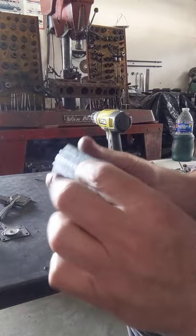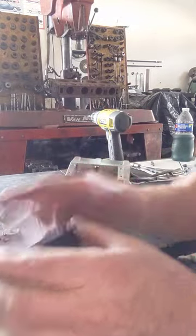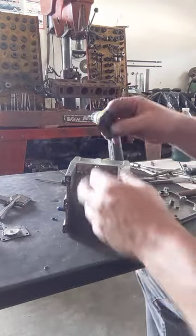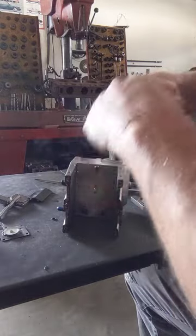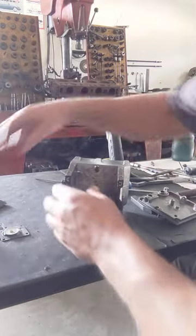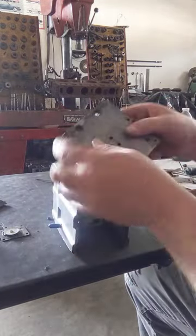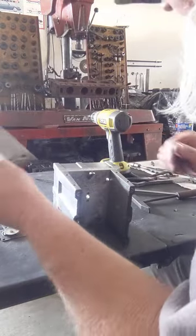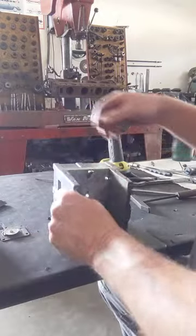That way the fuel goes in and it just floods out. Well, I shouldn't say flood. It's only going to give what you need as you're pulling, these butterflies are by air demand. So as the air moves them, it's going to pull fuel with this. Okay, that's it. So basically, again, those other shafts come out really nice. Nothing was bad.